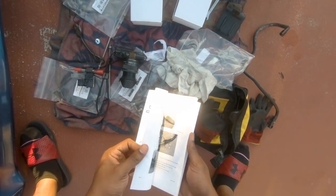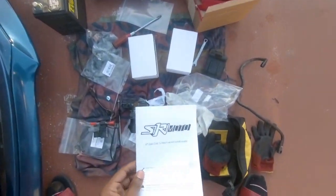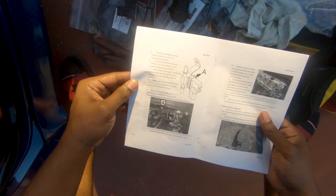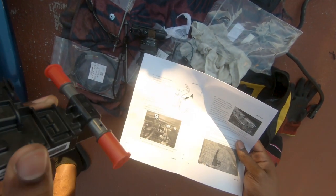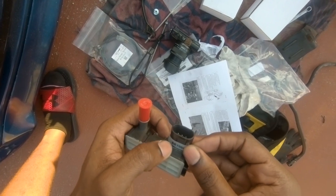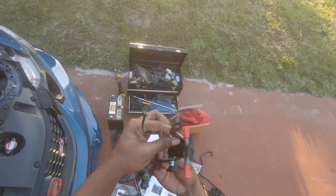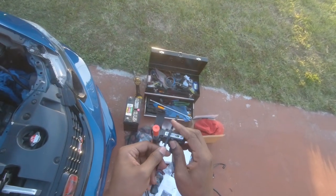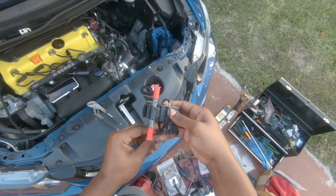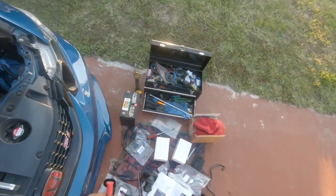This kit is really really simple. This guide right here — shout out to Sirmo for making a guide for their kit, finally a company that does that. Now we're on page eight and we're gonna install the flex fuel sensor. I'm figuring out how it goes — okay, so it goes like this. The mount goes on just like that, and what you're gonna do is grab the zip tie that comes with the kit and zip tie it on. Boom, then cut off the excess.